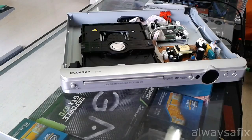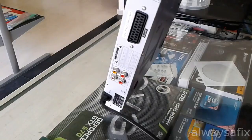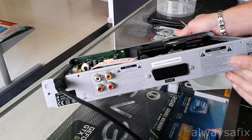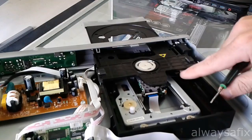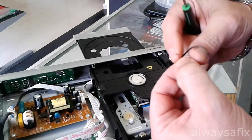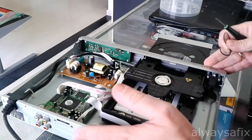I'll just connect the mains again. There's the motor there that drives it — and there's the problem right there. Hold on and see if I can get it out. As I suspected, the drive belt snapped. It's just rubber that corrodes over time, and this part which probably doesn't even cost one cent has caused this problem. So replace the belt and we should be good to go.